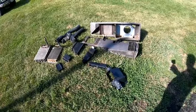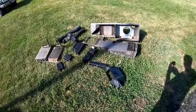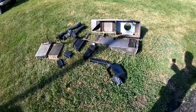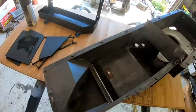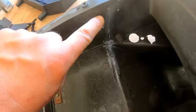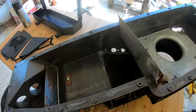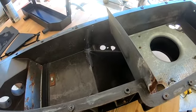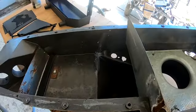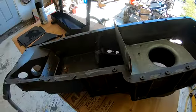That's a lot of pieces for a heater box — and that's not even all of them. There's at least one longer duct work I still have to dig out of another parts truck. All the little flapper doors are metal and need to get sandblasted. I'm about ready to start reassembly — got all my metal pieces sandblasted and painted, did that a couple days ago. One thing I forgot to mention: I found a crack that goes from right about there all the way down. It's weird, there's no stress on here. I don't think it's from flexing — I fixed it with epoxy on both sides and sprayed a little black on the outside.